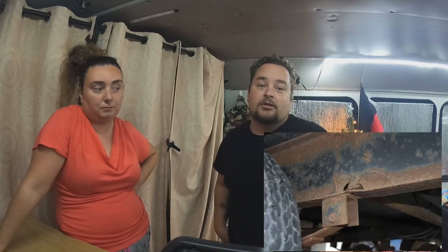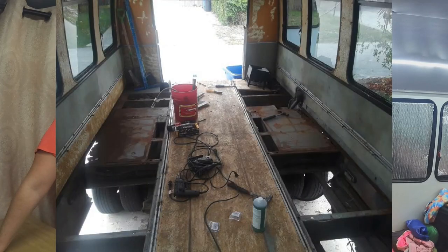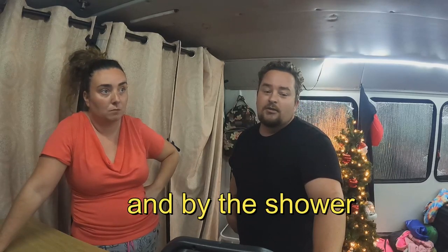Check every single corner of the RV for soft spots. If you're looking at a northern unit, you'll have salt issues — make sure you don't have a rusted or rotted-out frame. On shuttle buses, the only complaint I have is they just lay down plywood for the floor. If I lifted the plywood right now you'd see straight through — there's no metal underframe like a car. In a state with a lot of salt corrosion, that deteriorates the wood, so you can have soft floors. Also check the floors by the toilet, by the sink, in all the corners — that's usually where leaks happen.